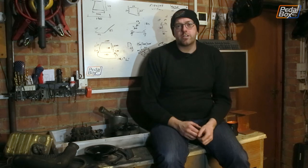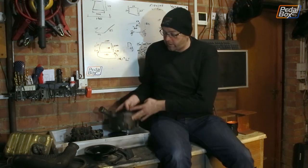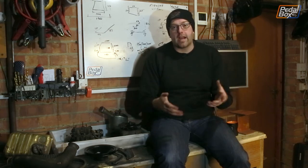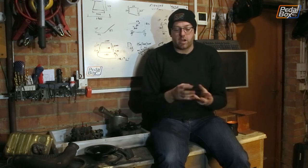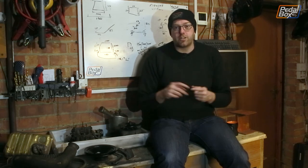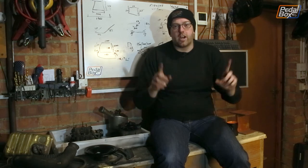We've managed to get everything back ready to go on, but between the carb and the wiring loom we've hit a bit of an impasse. We started going into the wiring — we've got to plug everything back into the alternator and put the sensors back on before reassembly — so we took all the wiring harness covering off and we're going to put some new loom tape and sparky tape on where needed to hold the bundles together.